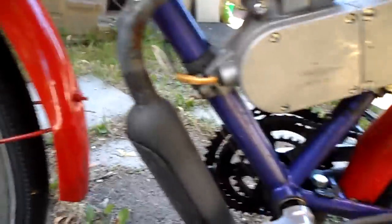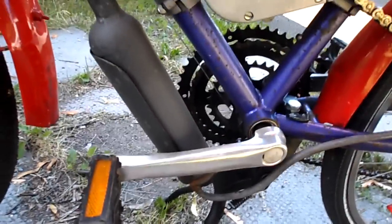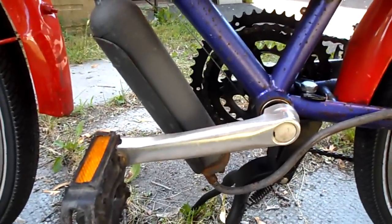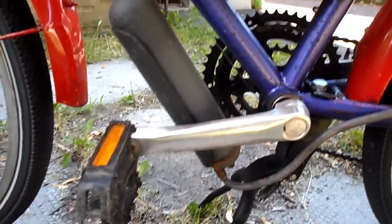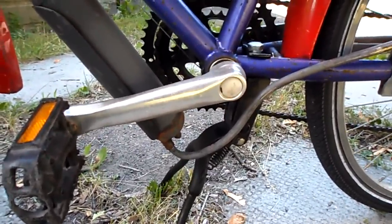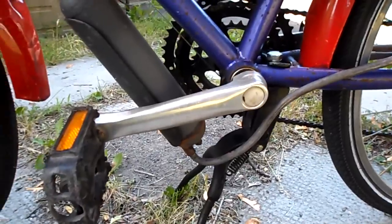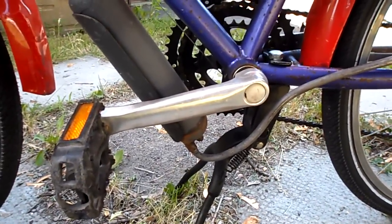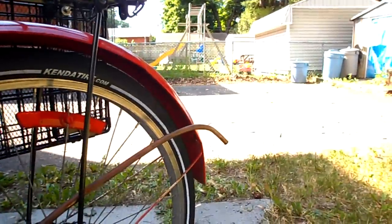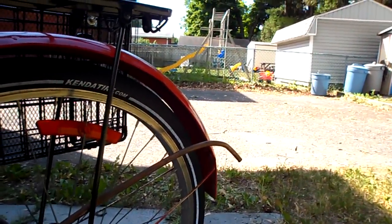You get this little exhaust here which doesn't really quiet the bike down much but it does clean it up. I added this pipe here which threads through and goes along here. The only reason I really did that is because it's a two-stroke and it puts out a lot of smoke. When breaking it in you put more oil in it, and basically the kickstand got covered in oil and the back wheel got covered in oil and the brakes were becoming ineffective. So me and my friend made this piece up from an old piece of plumbing or air conditioning — it just carries the fumes out to the back so I don't have to breathe them and I don't get grease all over my bike.